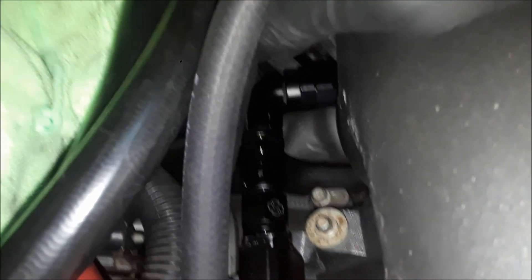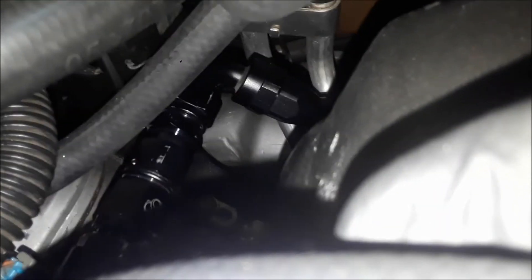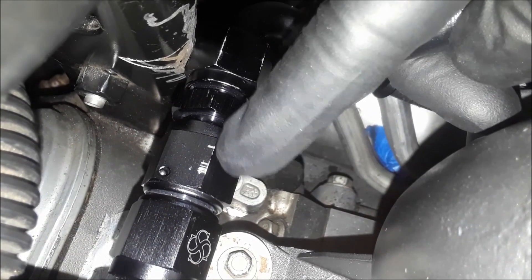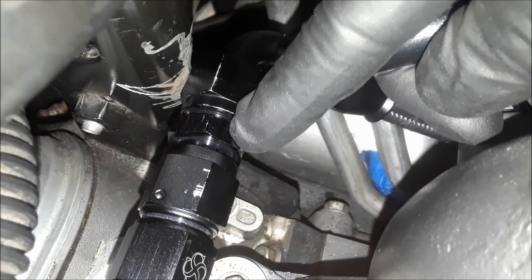Here's an update on installing your fuel rail fittings. For this crossover pipe that crosses over to the other side — that's the other end of this. A good thing to do is to have this not connected to the main fuel rail. Tighten up your fittings first before you tighten it down. This is the male-to-male end — it's inside here and it's inside the coupler. So I tighten up this coupler to this male end, made sure it was nice and tight, and then tightened this fitting onto the male end, then tightened this last.